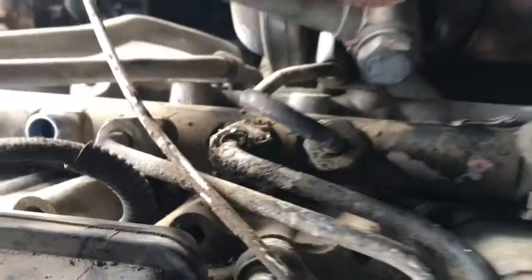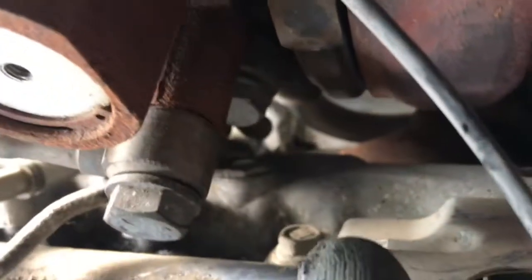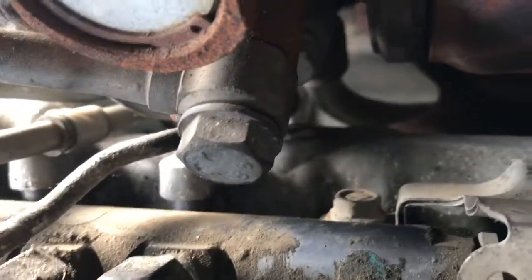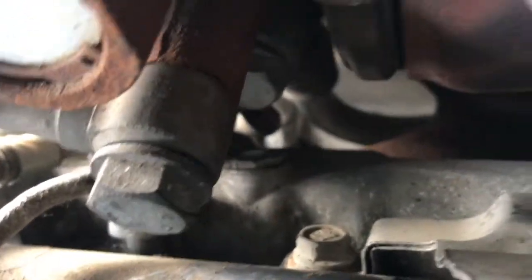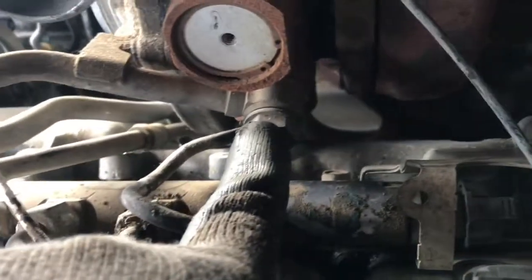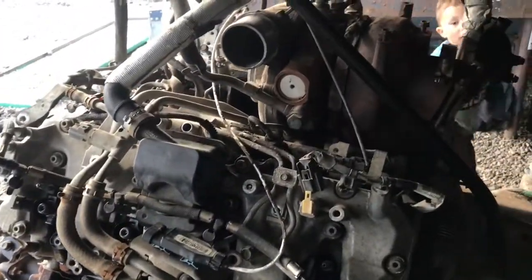For the back set, to get at it you need to pull this line here which is your supply line for the left-hand rail. Down underneath the turbo there is a hold-down bolt — of course it doesn't come out until it's ready to fall out and then falls right down under the turbo. Now I can finally pull this crossover line out of the way and then pull these two lines off. I think I'm going to end up pulling the turbo off, which will mean pulling this coolant return off. Down there are four bolts, and I still need the 12-point number 12 socket to pull the up-pipes off the turbo.